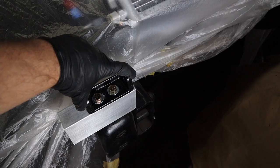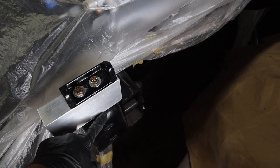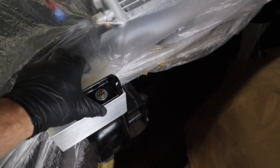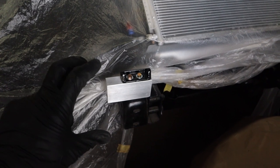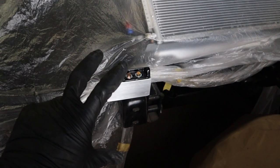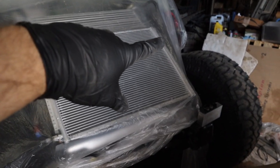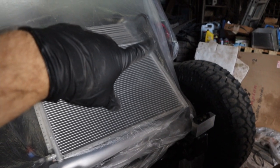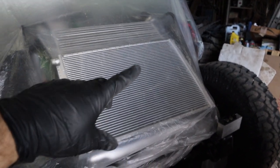This top piece can slide left and right, and down here they're slotted to slide forward and back on the hood. Once we have the hood in place and put the pin in, we can go ahead and tighten all that down so it's permanently located with no wiggling around. I do have the little retainer — a bar that basically holds up the hood once it's tilted forward — and I'll go ahead and put that on now.